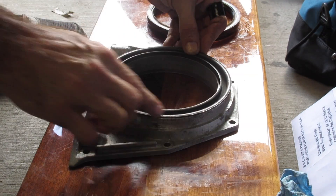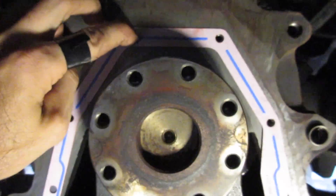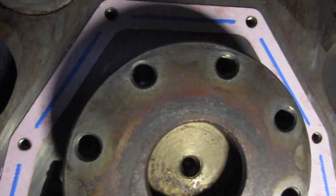When you hear the loud bang on all sides, that means you've bottomed out and your seal is installed. After cutting the gasket, everything lines up — all the holes are lined up and I cut it about 10 times on each side just to make sure I wasn't going to cut too much. I'll probably use just a smear of RTV to hold that in place because when I move my finger it falls off. All I did was smear some RTV around with my finger — I didn't want a real lot of buildup, just enough to make it stick. Now it's all stuck in place and glued down, and I'll put some pookie on the other side too when I'm ready to put it on.